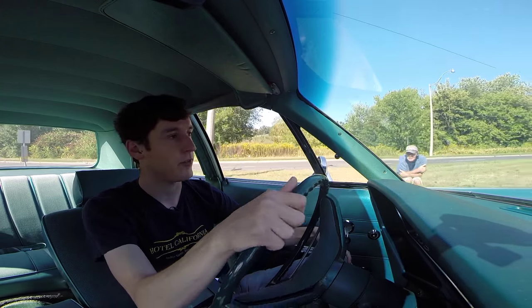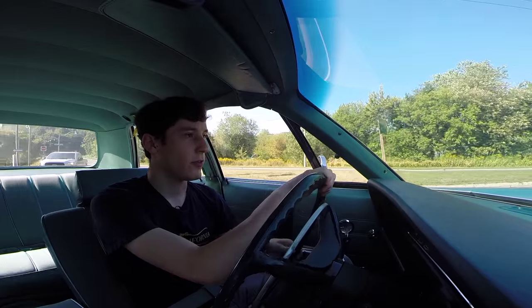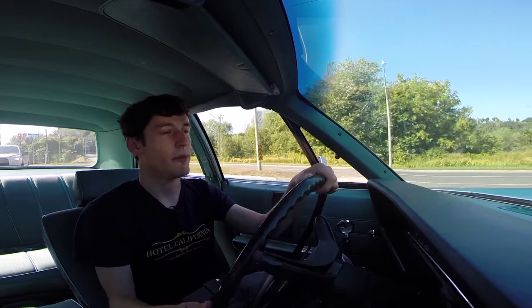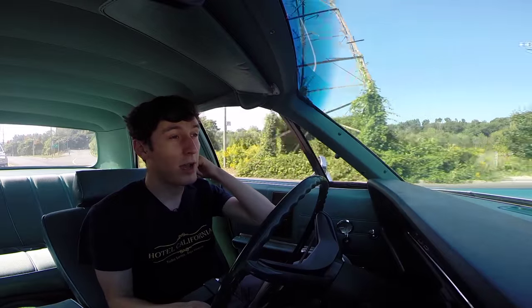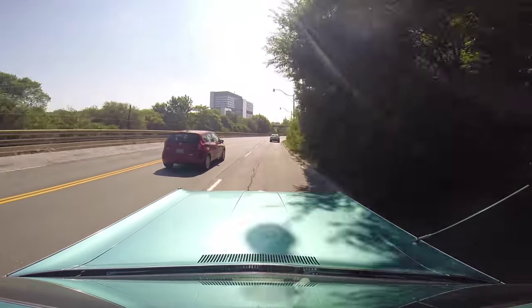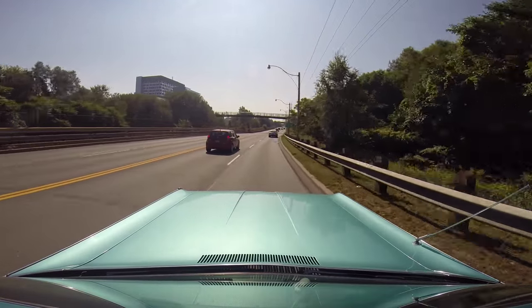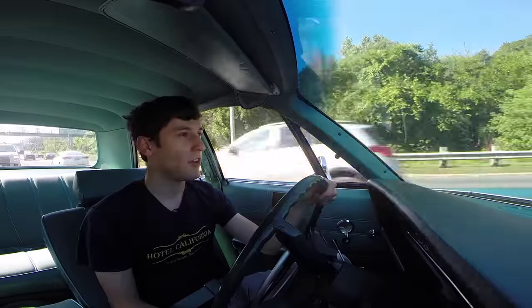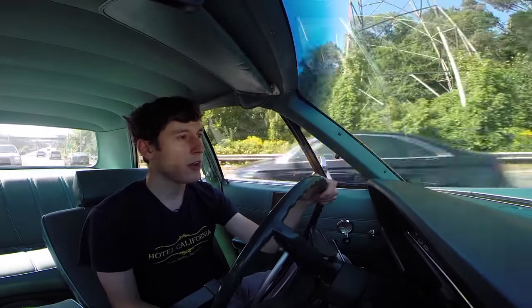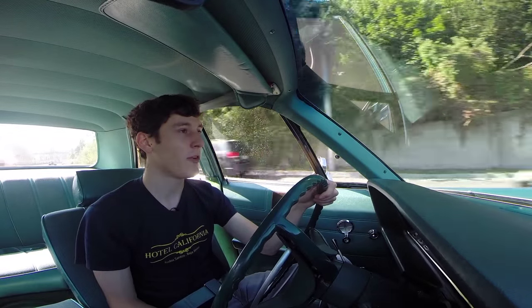Let's see if it's warmed up enough to give it some stick. So the kickdown switch — see how it almost died? You really have to warm it up a long time before you can floor it. It usually takes a solid 30 to 40 minutes of driving. Maybe it's a carb tuning issue, maybe it's an old car thing. It doesn't bother me that much. It drives fine at part throttle; you just have to let it warm up pretty well before you floor it.